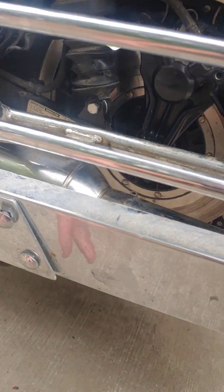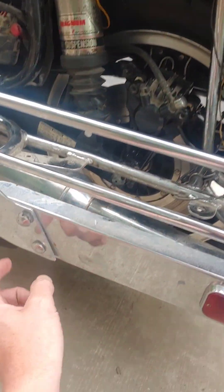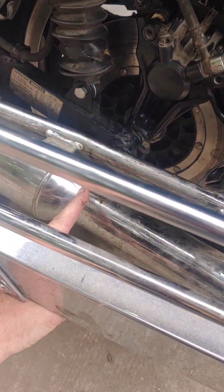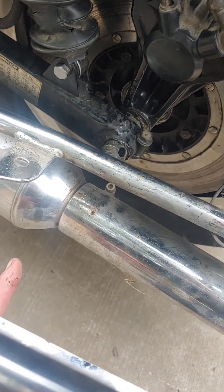Now on this one, I have this cool rack and I got the bag out of the way — the bag's up there. I had to loosen these bolts and these bolts to get room to flex this, because the axle path is going to come right over top of the muffler and right underneath it here.